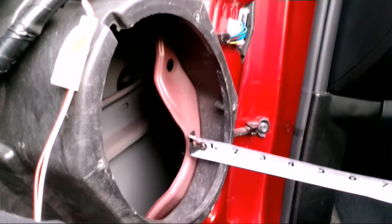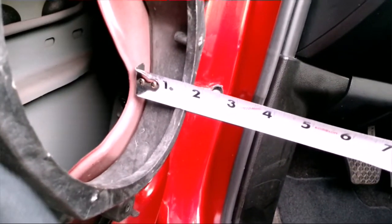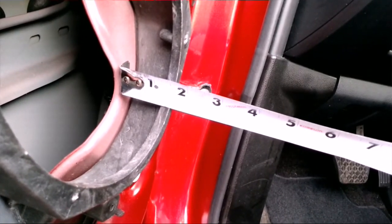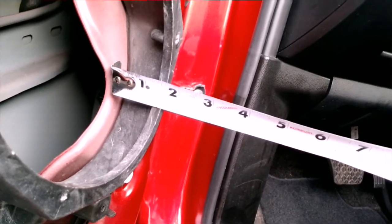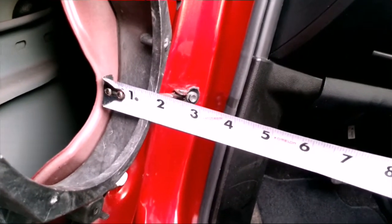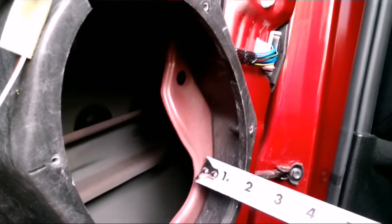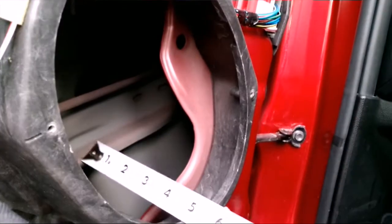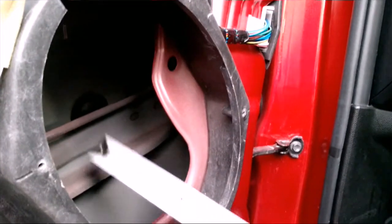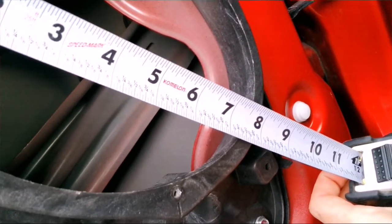Let's get a look at the hole. Back to the car door: if we take the shallowest part, you're looking at just over 1-and-a-half inches — 1-and-9-16ths to be specific. Just figure 1-and-a-half to be safe. If you're going to put in a higher-powered speaker, make sure the frame isn't sticking out further than that. There's tons of space for your magnet. Side to side, we're talking 7-and-5-eighths, and 5-and-a-quarter the other way.